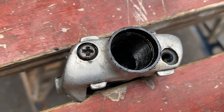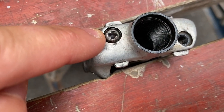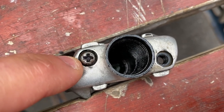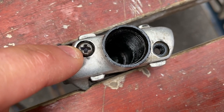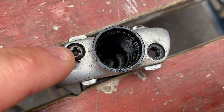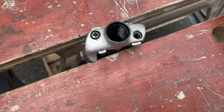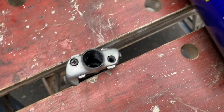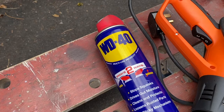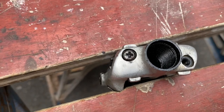You join me live at the critical point of no return. Anyone that's ever rounded out or stripped a bolt head before will know that you only get a finite number of goes at these things - if I keep fouling this up then the whole pedal, the whole project, goes in the bin. Given I've only got a very limited number of goes at this before I completely destroy the bolt head, I'm going to give this thing the full inquisition - the trifecta of penetration, heat, and impact. The penetrating lube did not work; 24 hours soaked in WD-40 and this thing's still not shifting.